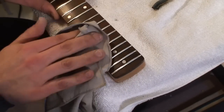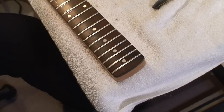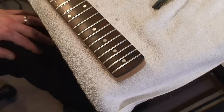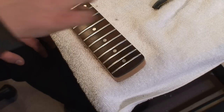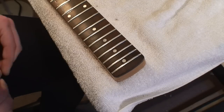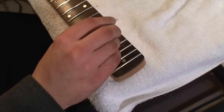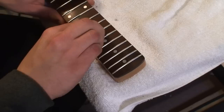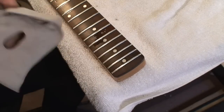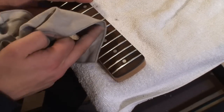I find that a really high grit sandpaper gives me a bit more control. I probably could have attacked this with something more aggressive than 1000 grit, but I find I can go quite hard with 1000 grit and be less careful about trying to burn through — it might take a little longer, but I have more control and I can go in and clean up little trouble areas pretty quickly. There we go, that's what I want.